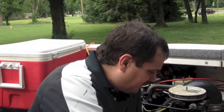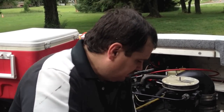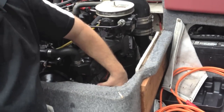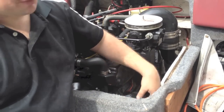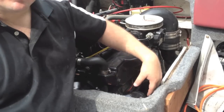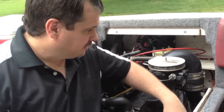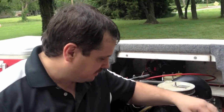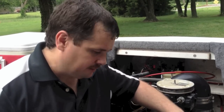First thing — unfortunately it's inside of this, and that's why we've got the Dremel tool, so maybe we can get in there a little easier. It's going to be a tight fit, not a lot of room to work. So what we're going to do first is take this alternator off just to get it out of the way. And before we do that, we're going to disconnect the battery so we're not shorting anything. So we'll get the battery disconnected, get the alternator taken off, and then we'll be back.